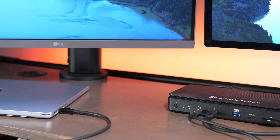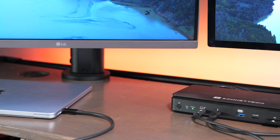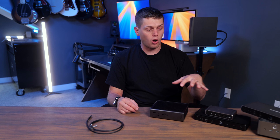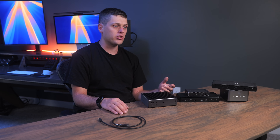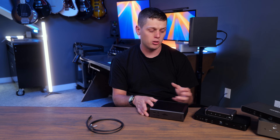This is really nice because whether you're going to work or bringing your laptop home, you can plug one cord in and be connected to your display, the network, and any accessories. These are all Thunderbolt 5 docks but backwards compatible with Thunderbolt 3 or 4. Just know that older devices will have smaller total bandwidth — Thunderbolt 5 supports 80 gigabits per second, boosted to 120 gigabits per second for faster displays, while Thunderbolt 4 topped out at 40 gigabits per second, so some incompatibility issues may arise.